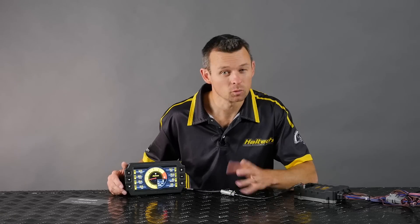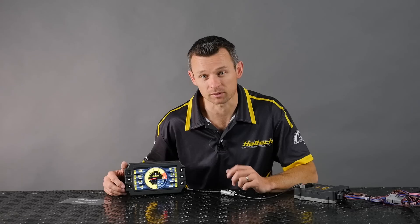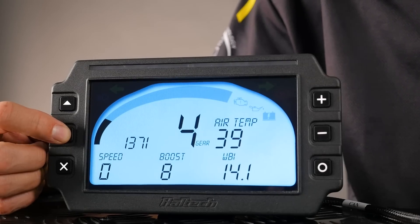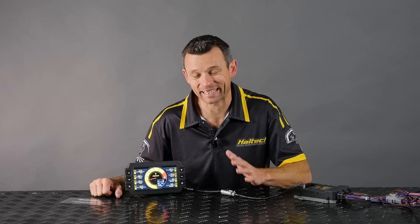No, it's not a touch screen, which is actually intentional. We found in our research of display screens that lots of people disliked how dirty touch screen displays get in their cars. So instead of going touch screen, we decided to include six control buttons on the housing so you can keep your screen clean and clear without those dirty paw prints. The buttons control things like screen brightness, display screen selection, and alarm clearing. There's also an array of 14 fully programmable shift lights across the top of the dash. Each of these LEDs are individually programmable as both a shift light or a warning light, or both. The LEDs in this array are all RGB LEDs, which means you can also program their display colour individually.